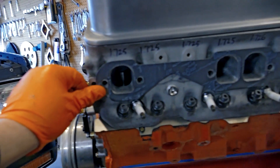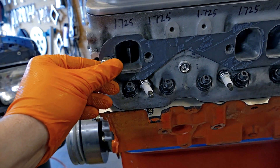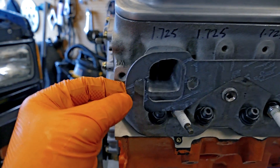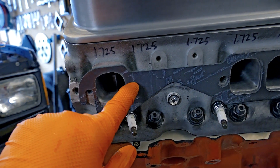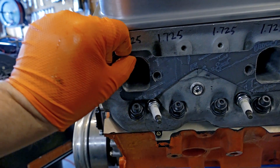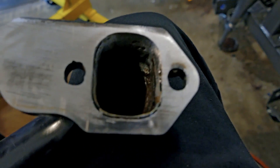Here's the gasket. You can see where I ported it. The fit had to wallow out the holes to bring it up, and the reason is because this sits low when it's on the bolt. I've already put this bolt in here — see how low it sits? So I'm having to bring it up to match the hole. I know that my spot where it needs to be is at the top of the port right here. You gotta be careful because these heads didn't really give you that much mating surface material. That's why you saw me earlier putting material on the top of that header — I don't want to just move the header on there and tighten it down, because there's a good chance after a while it might work its way down and you're going to have a blowout, with the port being blocked at the top. I added a bead there so there's no chance of that header coming down on this side, and I put one on the far side right here too.